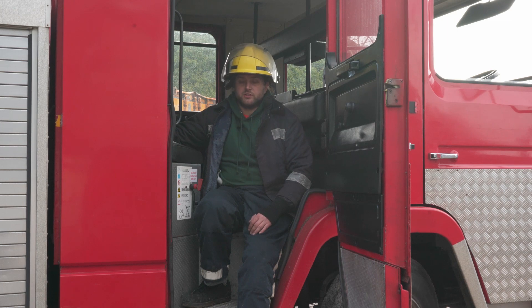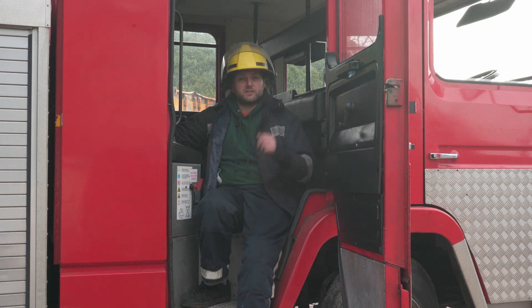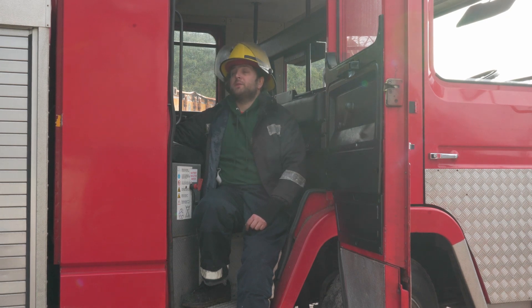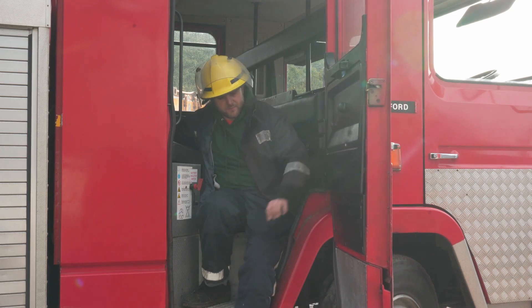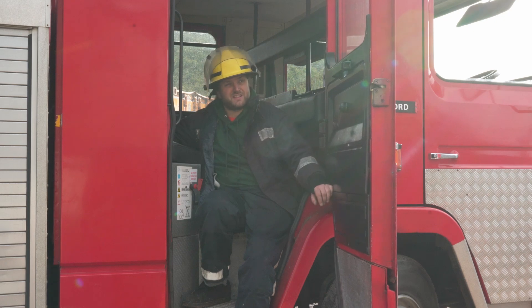She's a 24-volt system truck because she's a lorry, so there are two 12-volt batteries together. That means in order to plug anything in or replace bulbs it's all got to be 24 volt, not like standard car bulbs. Confusingly, under here positive is black and negative is red - I just don't ask how that came to pass. I really don't want to muck around with the wiring to sort it out. There are also some cracks in things like the side panels, but I literally can't get new ones, and you can see the checker plate where the original door rotted.